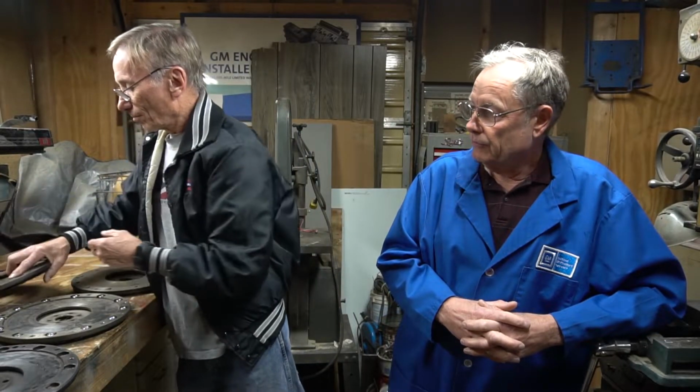Yep. If you've got a rattling flywheel, it'll eventually get to the point where the flywheel outer ring is contacting the starter nose, pushes it a little bit, and cracks it. So it's very important that the flywheel be centered properly, and that's one of the things that a proper bolted flywheel will do, is have it all centered on the assembly. Yeah, and that's another issue too. When you bolt them, you can't just drill out the holes and bolt it back together. You have to put it on a truing device to make sure that the flywheel is again back and round, because the rivets can offset the holes, so when you drill the holes they may not be exactly right. So when I see that one is badly worn, I'll drill the holes oversized so that I can shift that plate around and then nail it down with the torque of the bolt and get it in the correct position.